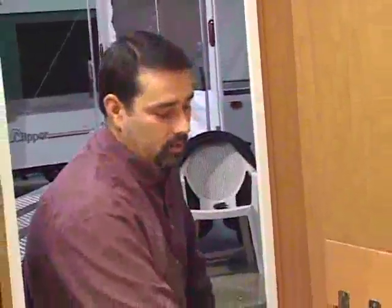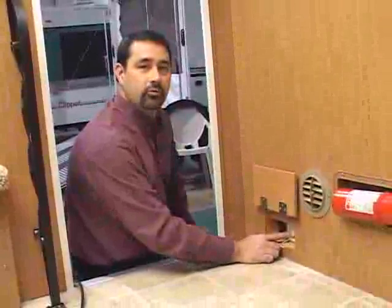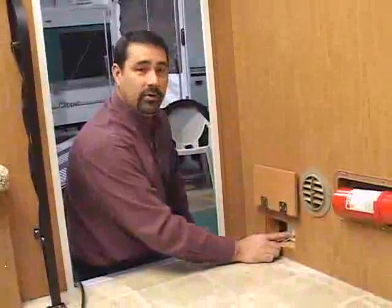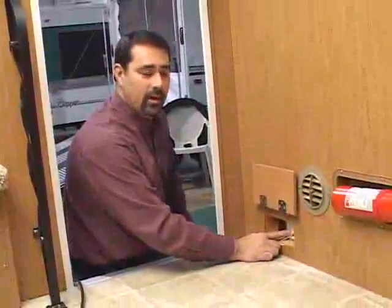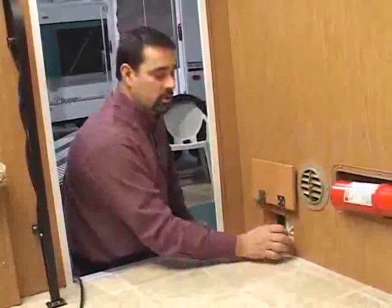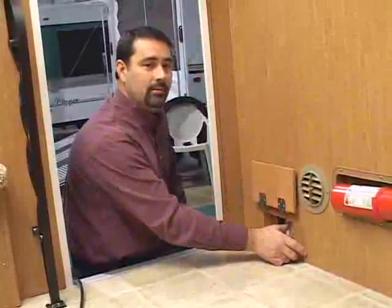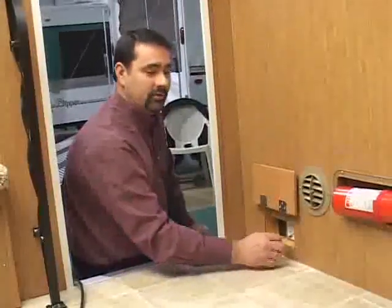Once you raise your trailer, it's important that you test the safety of the lock bar. The way you do that is once the trailer is up, without pulling on the safety, press the down button — the trailer should not move. If it does, then your safety is not engaging and it's time to consult a dealer to find out why. If the trailer doesn't move and the safety works, then push the up button again to take pressure off of the safety mechanism.